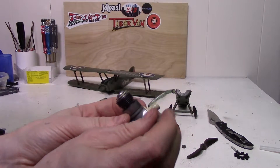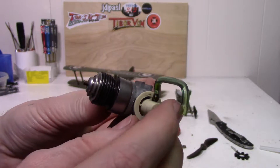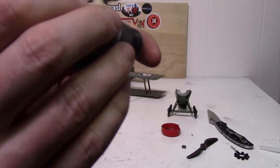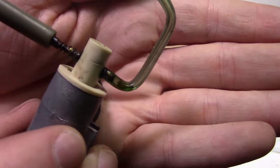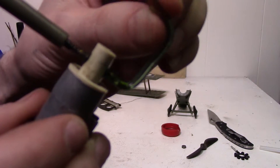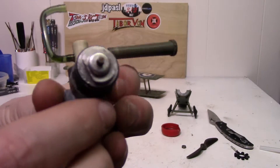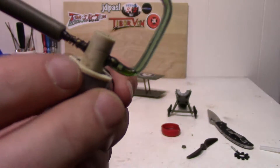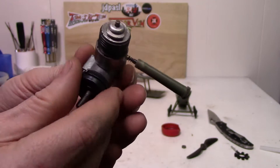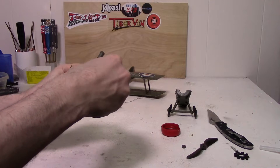You can see its little fuel line there, which is quite old now. It actually looks like there's some very old fuel stuck in the line. I will not be surprised if I have to put a new fuel line on — this thing has absolutely no flex to it now, it feels very brittle. And I'm just guessing the carburetor is in there. I don't really know if there's anything I can do to service it if it needs servicing.